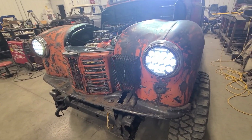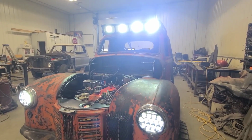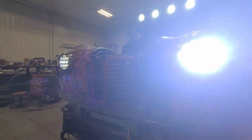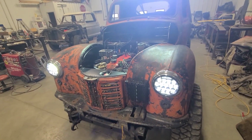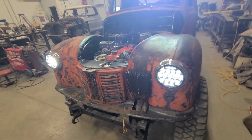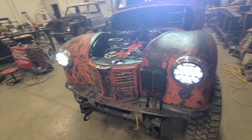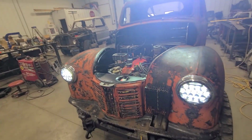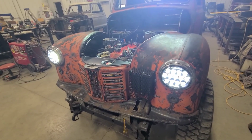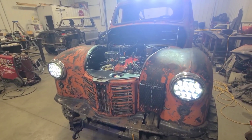We got our LED headlights installed. Just bought those off of Amazon, just like the roof lights there. They're now all properly wired up to a switch and all that. I didn't realize this, but apparently the new style round headlight bulbs use 2 positives and 1 negative to switch between the high and the low beams, whereas the old ones, like that old Ford back there, are 1 positive wire and 2 negative wires. I couldn't figure out for the life of me why they wouldn't light up when the wiring was all done the exact way that the Toyota had it from factory.